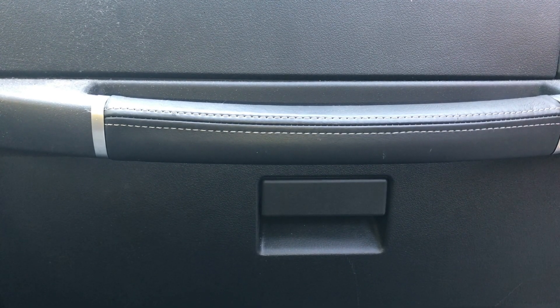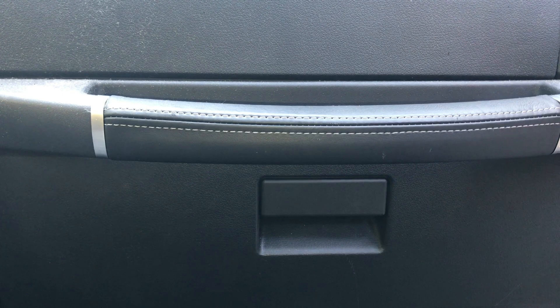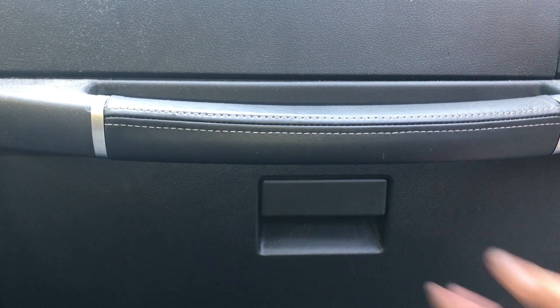A perfect example of that is cabin air filters, like the ones this 2010 Jeep Liberty is equipped with. I'm going to show you how to change these today. There are two filter elements for this Jeep Liberty — I let one go about a year and a half so you can see how dirty they get, and the other is about six months old or 12,000 miles, which is right where Jeep says you're supposed to change them.